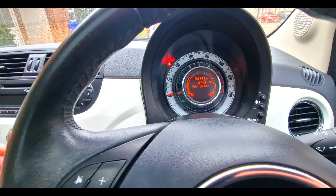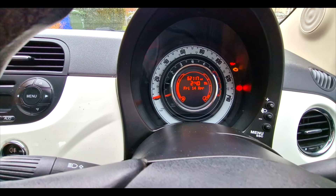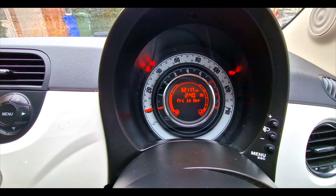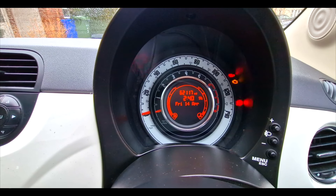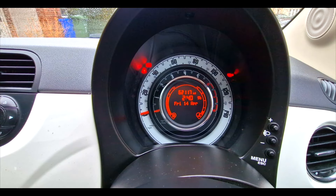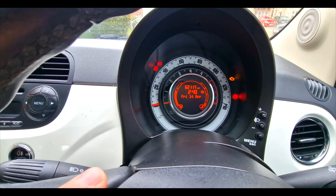However, the only thing I'll say is you will get the flashing mileage coming up and you potentially still have to do a proxy alignment, which is going to be a slight issue. I have used a laptop with Multi-ECU Scan — a piece of software with a cable that plugs into the diagnostic port behind this cover here — and it will do the proxy alignment and stop the mileage from flashing.